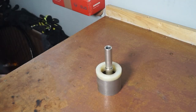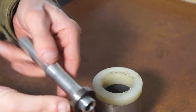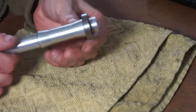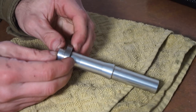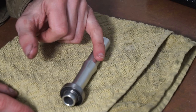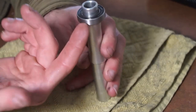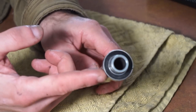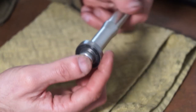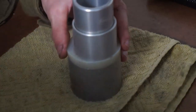Just give the axle a little tap, make sure the cap is on nicely, and that comes out very easily. The bearing comes out on the shaft — we'll get that off after, it's not massively important right now. What we want to do is remove the bearing from the axle because we want to use the axle to get the remaining bearing out of the hub. You could put this on the edge of a bench so the edge is sitting on the bearing, and just tap the top — I use a nylon hammer not to damage it.